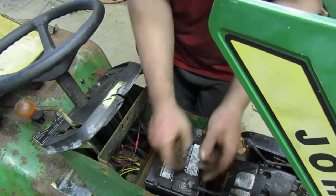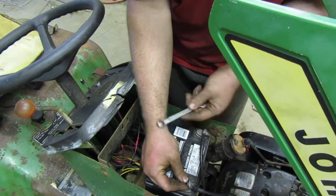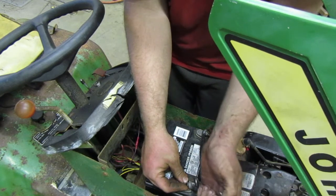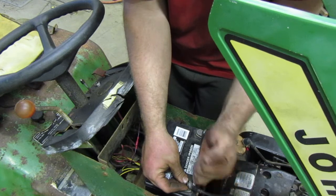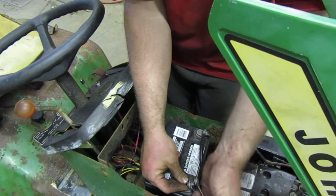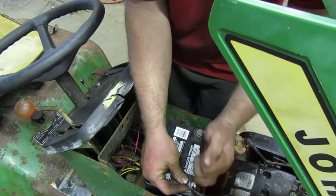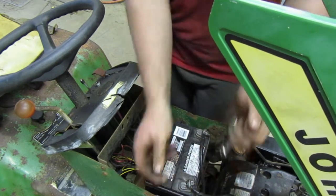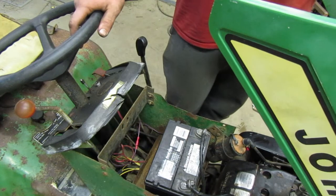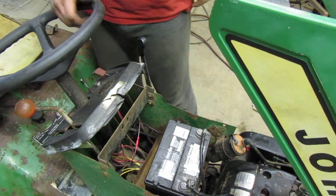To take the hydraulic fluid out of it, I will show you guys this up on the forklift. There's a cooling tube on the transmission you take off. You loosen the tube or just completely take it off, which is probably what I'm going to end up doing. Take that off and then that's the bottom of the transmission, so your fluid is going to drain out. And you also take the transmission fluid filter off. I'm not sure how tight that filter is on this one. Hopefully it's finger tight. They say you're supposed to just tighten it up to the point where you can't with your hand anymore. So that's how tight it should be. I don't know how tight it is.